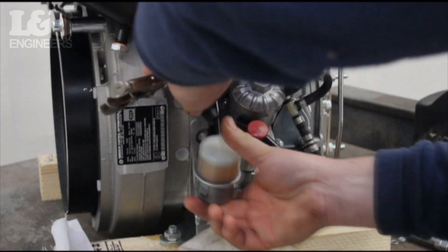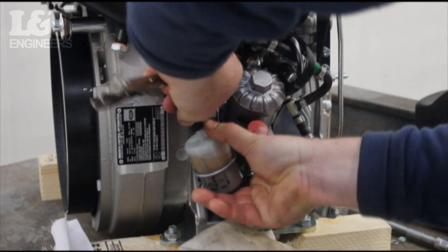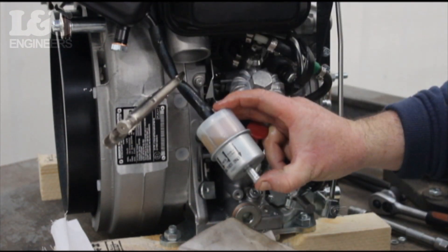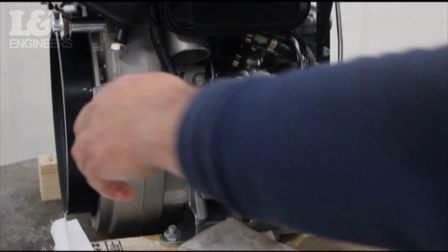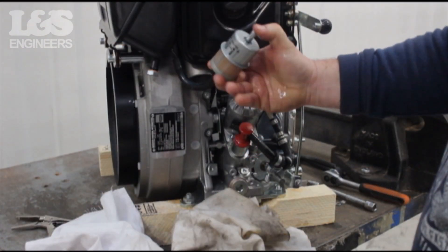You can now change the filter. Make sure the arrows are pointing down. Reattach the top of the filter back into the hose. To bleed the air out of the filter, remove the pliers and tilt the disconnected side upwards until the fuel is slightly pouring out.